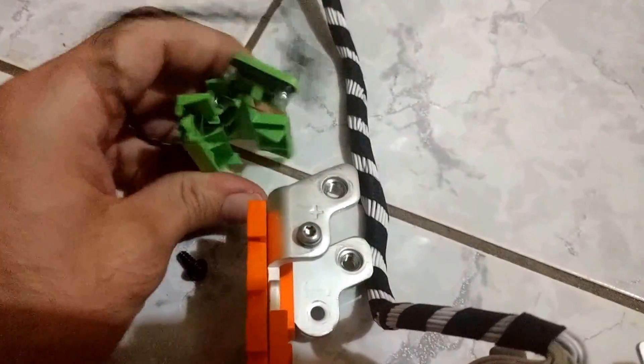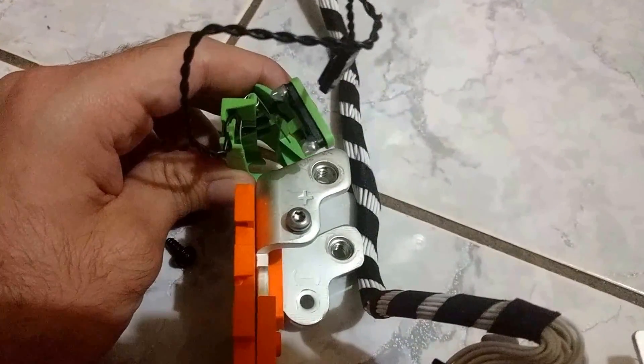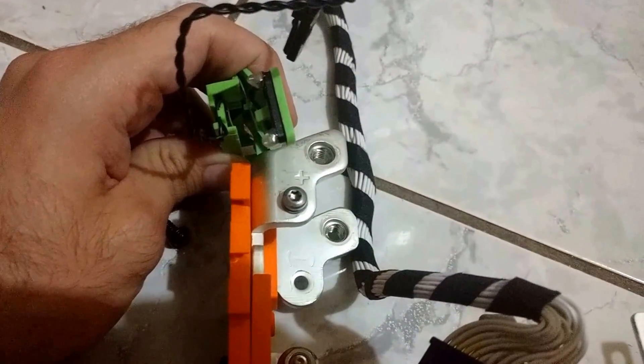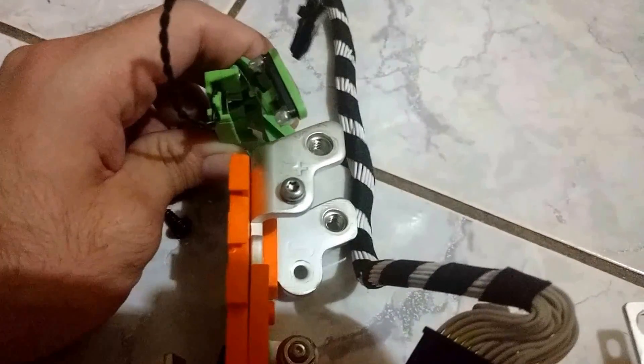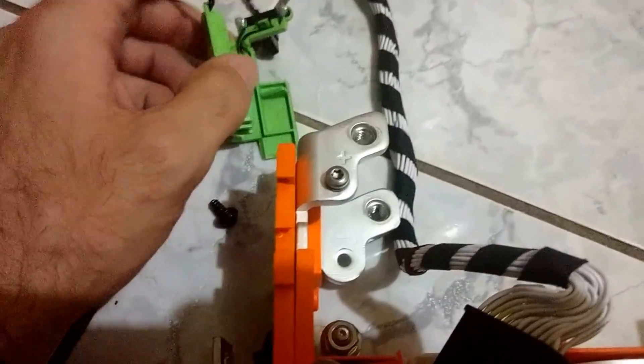I also figured out what this thing was — I had an impression it was a safety switch. It goes on the wall of the charger and I think it's a reed switch. It will close whenever the battery cables are connected as a safety mechanism, so you don't charge the car without the cables connected or if they fall off. This cable over here is the data cable — I think it's a 40-pin cable — that goes to the control board right here at the bottom.